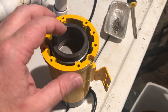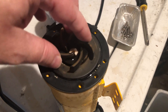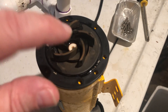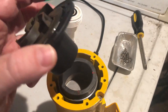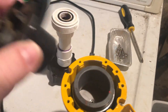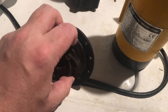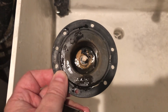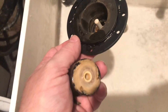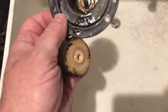No water was pumping out of the thing. Normally this is screwed on there, and the power spins with that magnet, but this wasn't spinning — it was completely seized up. I could immediately tell something was wrong because this magnet is supposed to force the impeller to spin with it, but it wasn't going anywhere. I had a really hard time getting this out of there. As you can see inside, there's that ceramic shaft, and there was all sorts of crud built up behind the impeller — just caked up and preventing it from spinning as it should.